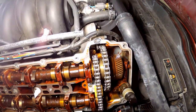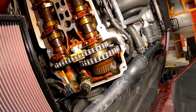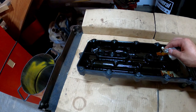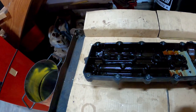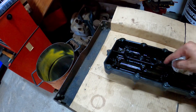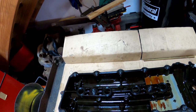You can see where I put a little silicone here on the new valve cover gasket, and then down here where that front cover meets the head — that's where you want to put a little something for that small gap. We'll be cleaning that off and putting new on. We're going to attempt to reuse these gaskets as they don't seem to be bad. I have a feeling the problem is actually the valve cover itself — it probably got a little warm at some point and flexed or bowed, and now it's not holding a proper seal. We'll clean all this up and most likely put a touch of silicone on all these ports rather than buying a whole new gasket kit, to get a definite seal.